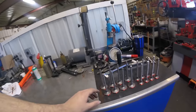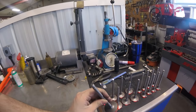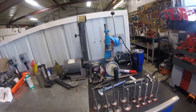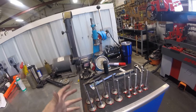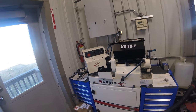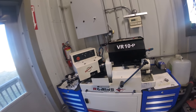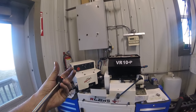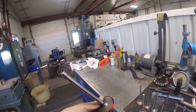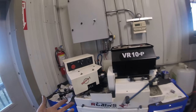While the head is surfacing, I'm going to go ahead and regrind all of the valves. These are brand new valves so coming from the factory they should be good out of the box - and when we did our vacuum checks earlier they were all holding vacuum. That said, we recently purchased this new Robins VR10P valve grinder back in January and it's only about a year old with less than a thousand valves ground. I know from experience our machine is probably going to do a better job than any factory machine that's done maybe a thousand valves a day versus our basically brand new machine.